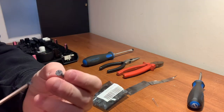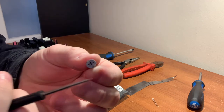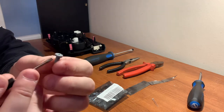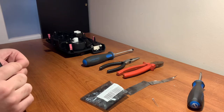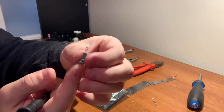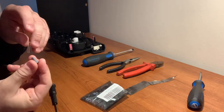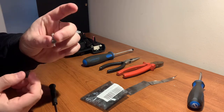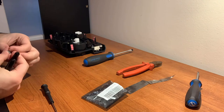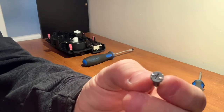See how that just fell right out. You're going to have to reroute the wire so you can take the bulb out — see how it's all routed up in there. When you put the new one on, you're going to put it back exactly the same way. Reroute it out, and there you have it — there are the two wires. Push up on the wire so the bulb will come out and just pull the bulb out. Putting it back in is just as simple: slide it in, pull it down, and reroute the wire. Do that to the rest of them.